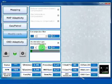Or maybe you can have a decrease of gas, mainly in CNG systems, because CNG in acceleration could bring to a richer mixture and the car loses power. So to have a leaner mixture and a little bit more power while accelerating, you can decrease here, I think about 10%. However, you have to see on the car itself, and you will have better performance.